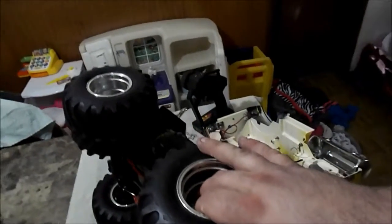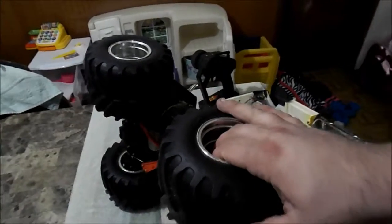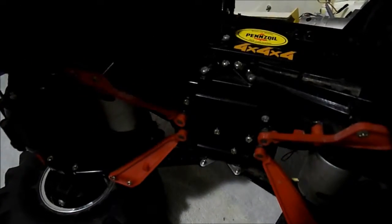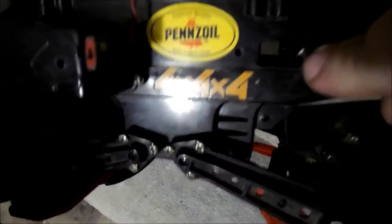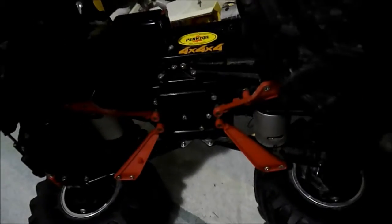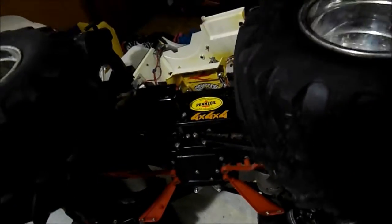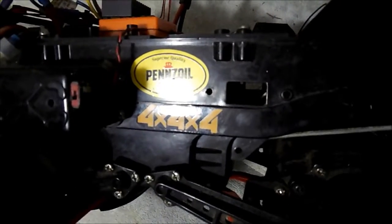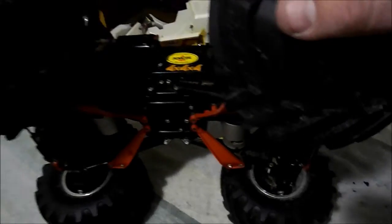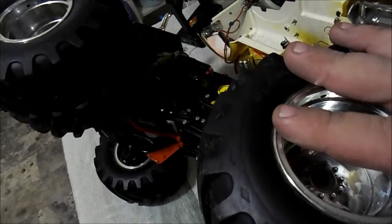It works if you're moving or if the tires are off the ground — all four tires will steer and it'll go the direction you point it. Both diffs are unlocked. The motors — I can't remember exactly what comes stock, but I want to say they're 21-turn 540-size brushed motors. The Clodbuster and Bullhead originally had a switch where you could wire the motors in series or parallel — one gives more run time, the other faster speed. That feature isn't wired in on this one, but the motors are currently wired for more run time.